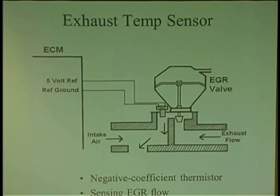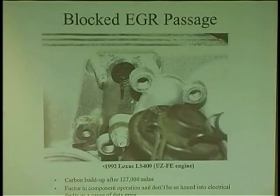So if you get an EGR code that says there's an EGR fault, you can't just check the EGR solenoid to see if it's sending vacuum to the EGR valve, to see if the diaphragm is pulling, and then go there with a tool and suck down the valve to see if there's change. The computer checks for temperature change. You think it's going to have temperature change with that? What's that? Crud, a clogged passage.